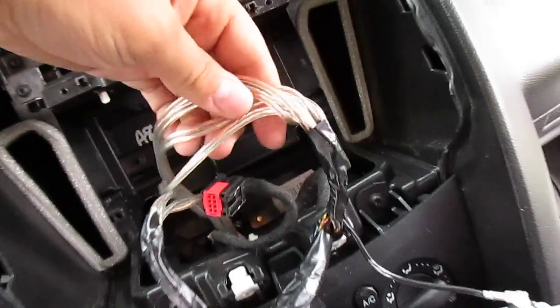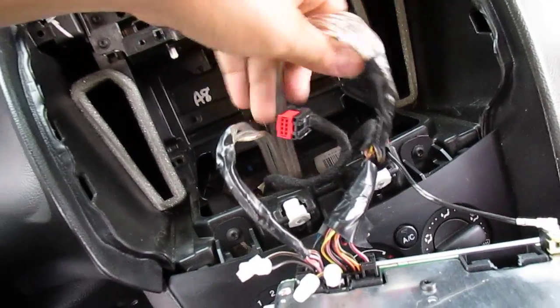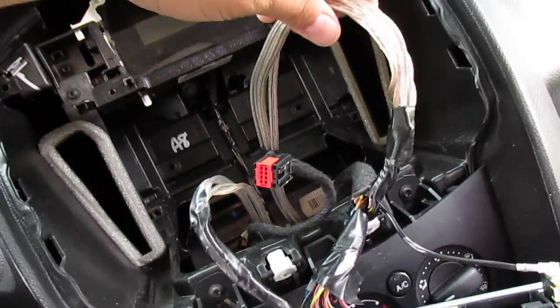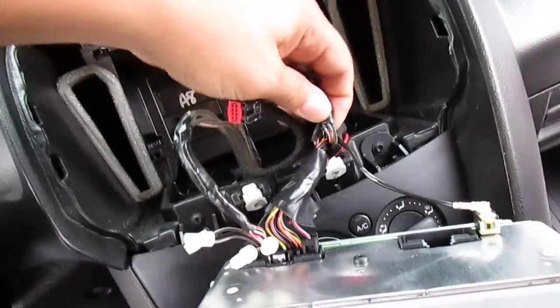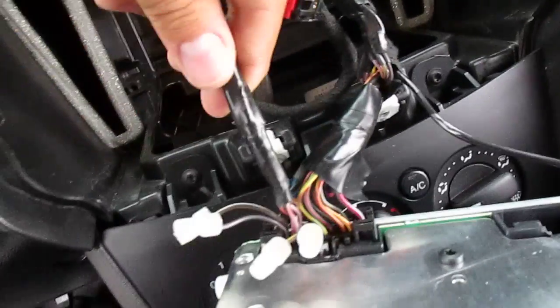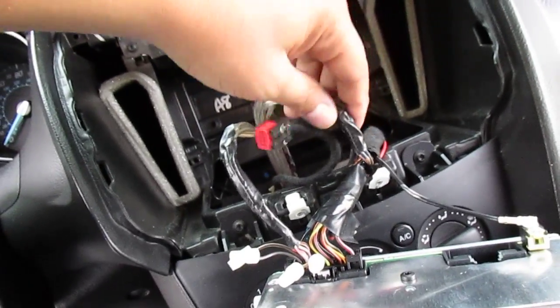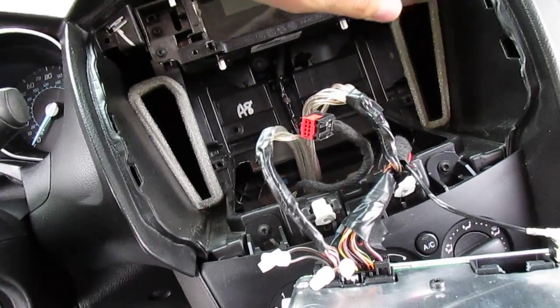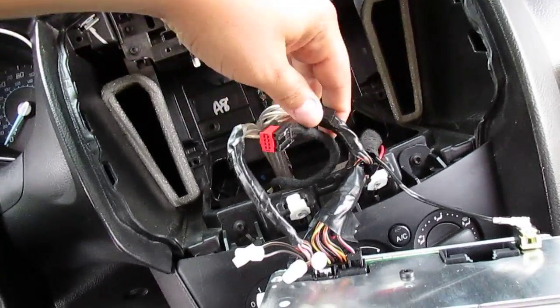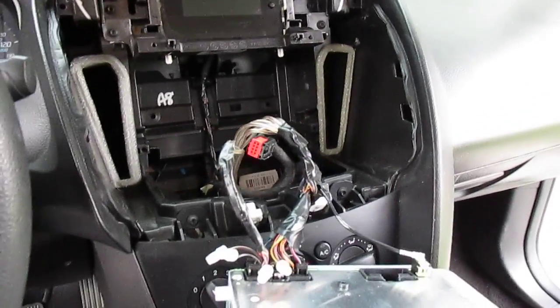Then these wires, these four, are from the 5-channel amp I have in the back. So these wires are powered by the amp already through the LC2. It's going to be the same colors I just read off, plus the first set for the input to the LC2. And I'm just using the stock wiring harness to send all the power to all the door speakers through the factory wiring. I'll have that in the description below. And that's about it. Under here, you're done.